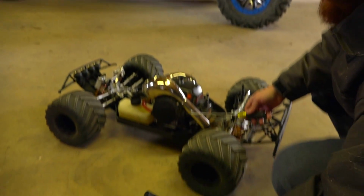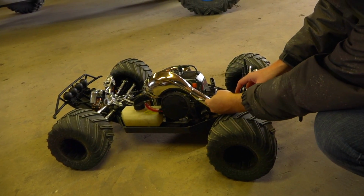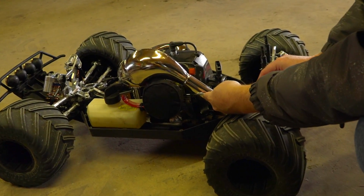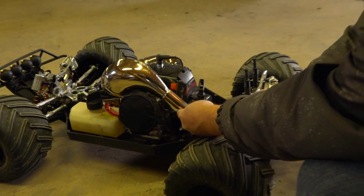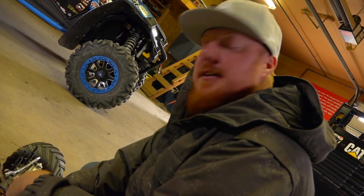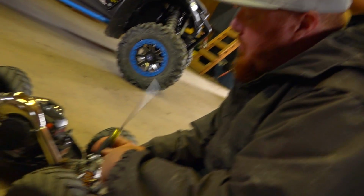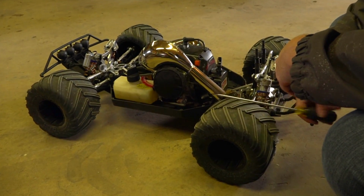Okay, we went for lunch, we're back. It's cooled off for the last 60 minutes, so everything should be cool to the touch. What are you gonna do now? I'm gonna reset the needles and set them. Okay, so you're setting needles to stock again? The high and the low. I'm not sure what stock is, to be honest with you, but in the video that Dan at OBR posted, he said that he puts the low to 1 1/4 and high 1 3/4 as a starting point. Okay. Using this engine.